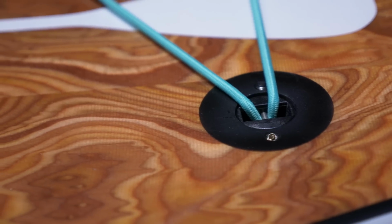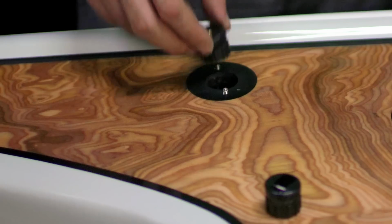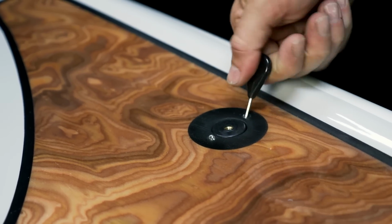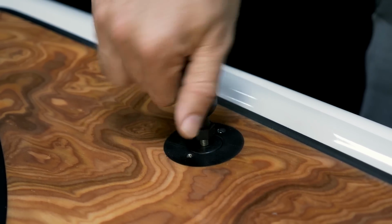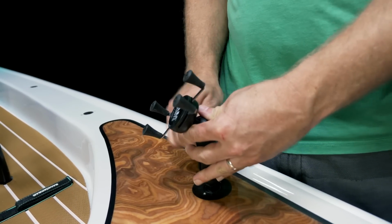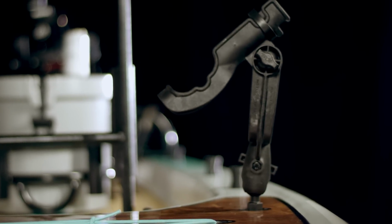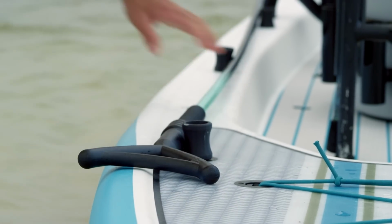The top of the rails are lined with a series of connect-up plugs. These attachment points can be swapped out with various plugs to outfit Rover the way you want. Simply loosen or tighten the set screws to remove or install. The most popular plug features a 1/4-20 threaded attachment point, perfect for adding any number of attachments available from Ram Mount or Scotty for things like fish finders or additional rod holders. Attach the included vertebrae to add a convenient place to store a sand spear or paddle.